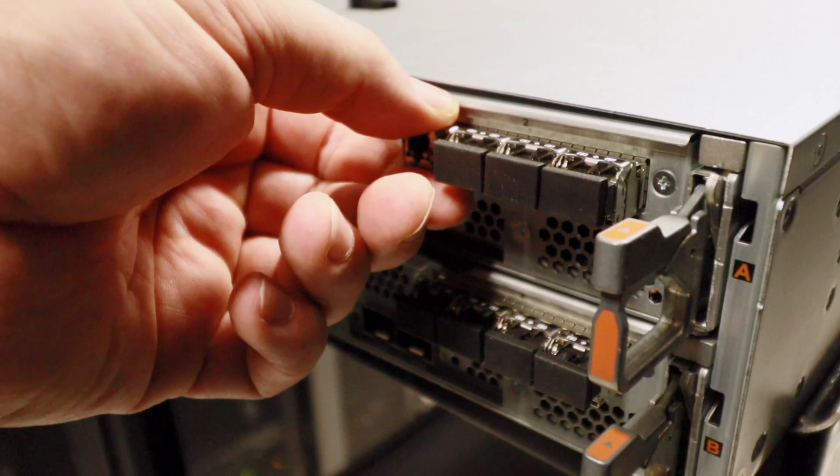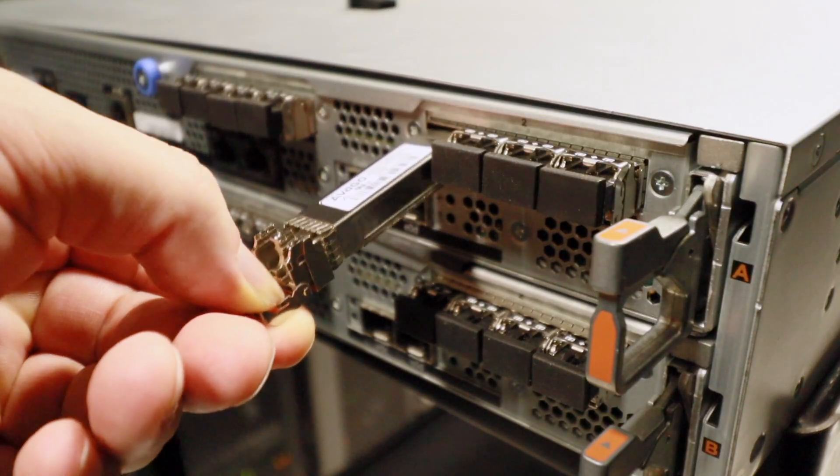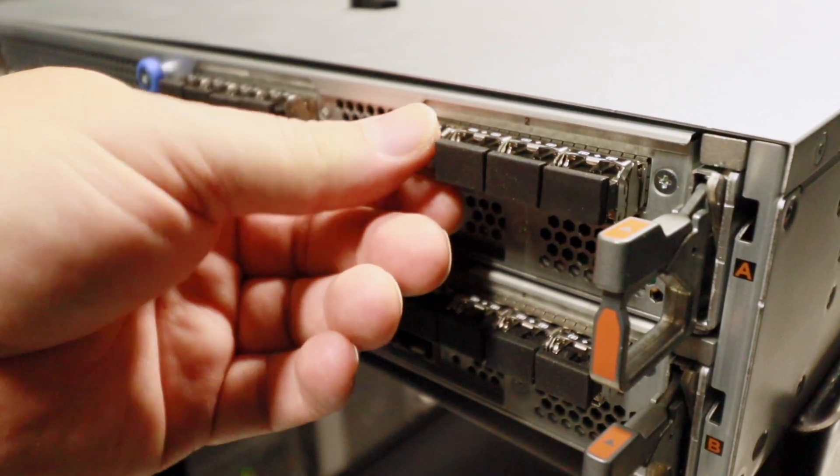With that out of the way, let's shift gears and talk about I/O connectivity. The A220 was previously offered in two very static configurations: Unified and Ethernet. The Unified configuration provided four UTA2 universal target adapter ports per controller. Using port personalities in ONTAP, you could easily modify each port to accommodate either 10 gigabit Ethernet with SFP+ modules or copper cabling, but you also had the option to utilize 16 gigabit Fiber Channel — very flexible, hence the name Unified. The Ethernet configuration was simply built with four RJ45 10 gigabit ports on each controller.